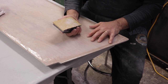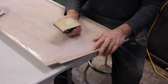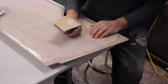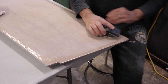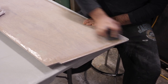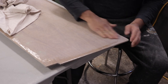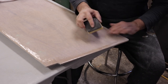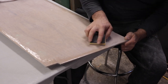These are some of the last panels that I'm actually doing like this on the boat. I tend to skip the sanding part and just fast forward or not show it at all, and I don't want to give anybody any delusions as to the amount of work it takes to sand this stuff down and make it look good. It is a process and you've got to do it if you want it to look good. You can try doing it with the dual action sander — you're going to get it smooth, but you're not going to get it as flat as you can with a block or a long board, which I'm going to do this entire panel with eventually.